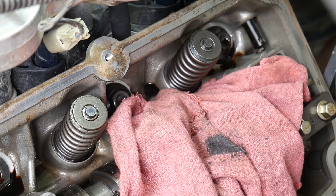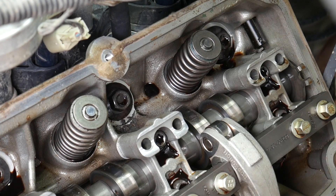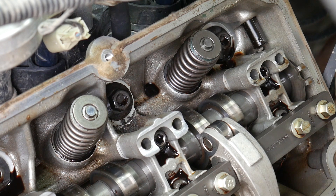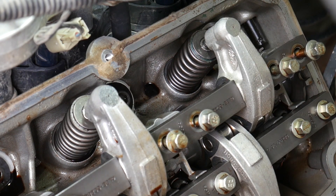I didn't get the full footage of putting it back together because I didn't push the record button on my camera, but this is a new valve seal, new valve spring, and I reused the old retainer and the old keepers. The installation process is the exact opposite of the disassembly process. Once all that stuff's back together, you can remove the rag and reinstall the rocker rail. Now the rockers do have a strange torque procedure — once you get them all snugged up lightly, you tighten them to 10 newton meters or 89 inch pounds, then the next step is 20 newton meters or 177 inch pounds, and then after that you have to tighten them a further 60 degrees. I hope this video helped you guys if you had to replace a valve spring on your Ford with the 6.2. Thanks for watching, and I'll see you guys next time.